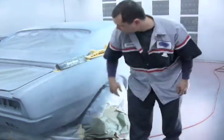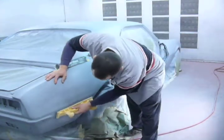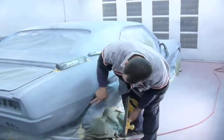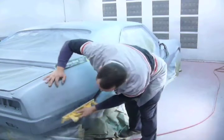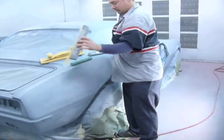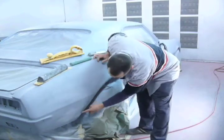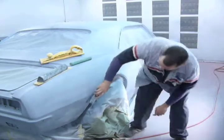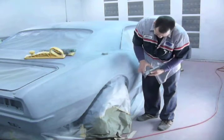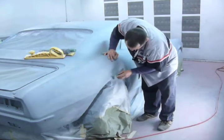For this bottom piece, I'll do a couple strokes with this block right here. You can't do too many because there's not a lot of room, because there's a little lip right here and you got this, so just do a few of them and then I'll switch to the teardrop and do the rest. And right where this lip is, where it goes outwards, I'll kind of go like that. For this flat area right here, I'll take paper about that wide. Block like such.